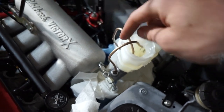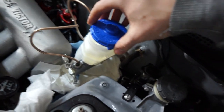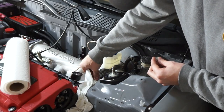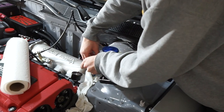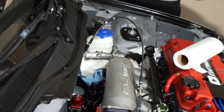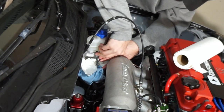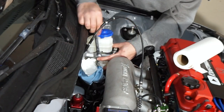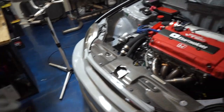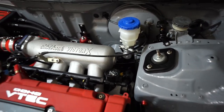To help keep fluid from pouring out of those fittings when I take these lines off, I'm going to go ahead and bend the copper lines out of the way and throw the cap on just to help seal it up. Make sure you've got these really tight. Just like that, we've got our old 7/8-inch stock diameter master cylinder out of there and our new 1-inch Type R master cylinder installed. Super simple install — literally two bolts, two lines, a little bit of bleeding, and you're good to go.